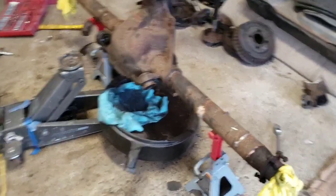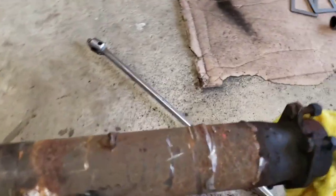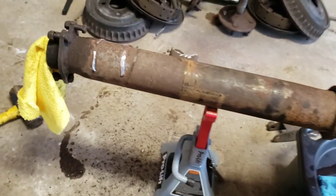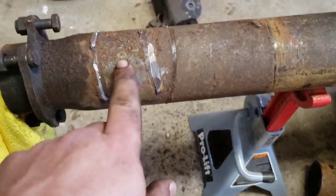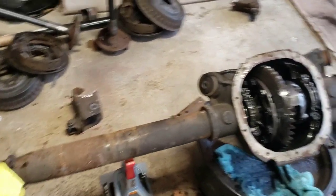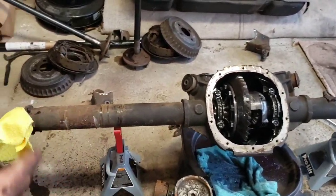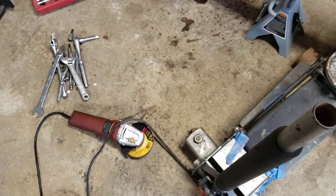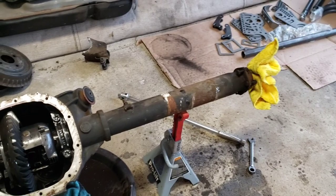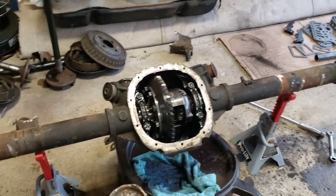After a little bit of cutting, I got all the brackets off. They came off pretty decently. I didn't get into the axle very much at all — this side I did just a little bit. I'll blend that all out. I am going to strap this thing down so it won't spin around once I do start welding stuff on it, because I did not want it to move once I start welding. I'm going to put my grinding wheel on there and get all this cleaned up on both sides. That might do it for today. It's looking good though.